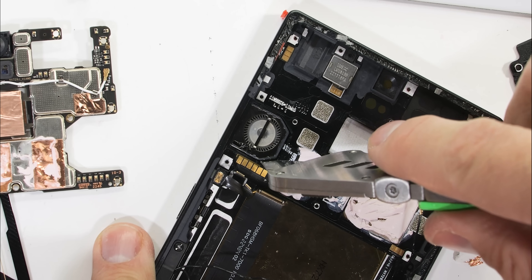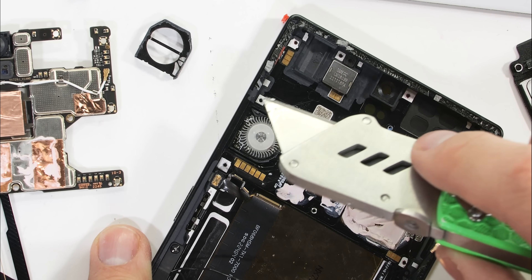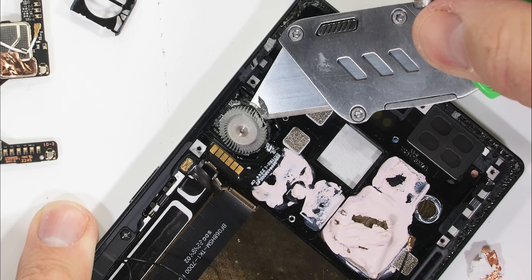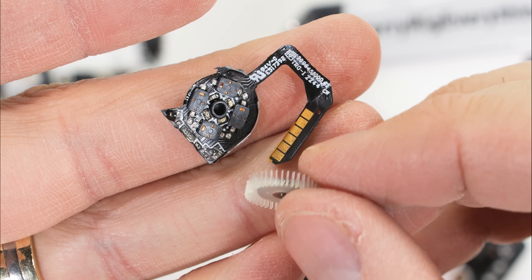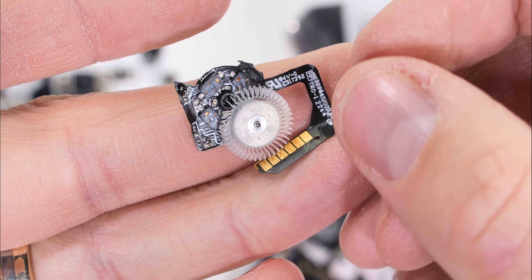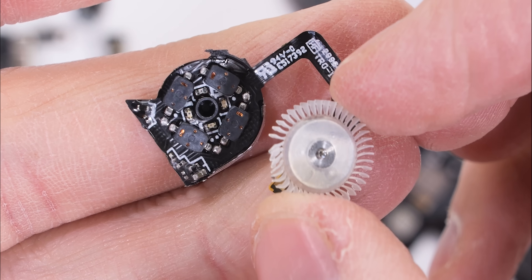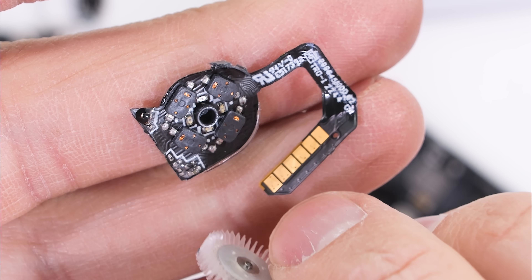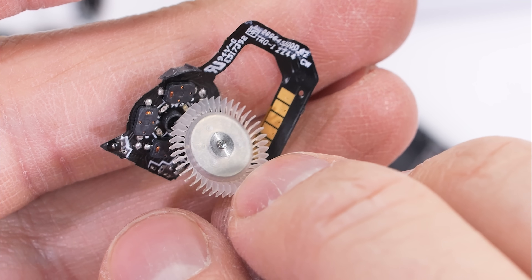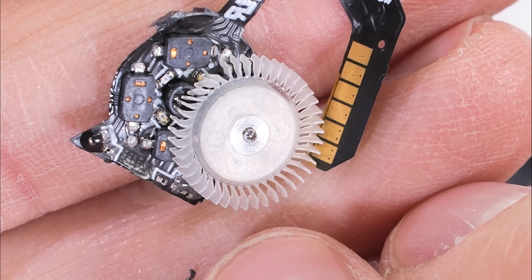Our little fan buddy is very securely attached to the phone body — no real easy way of extracting it safely or in one piece, but we still have to take a look. The fins on the fan blade are made from a translucent plastic, and the LEDs that shine up through the fan are embedded on the ribbon that powers the whole thing. No Lego-style plugs on this unit, just square gold contact pads that rest up against the motherboard. So yeah, my fan is definitely broken now. But just like with all games, sometimes you don't win, and that's okay as long as you had fun along the way.